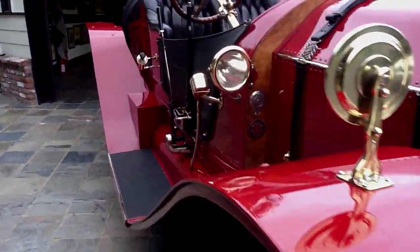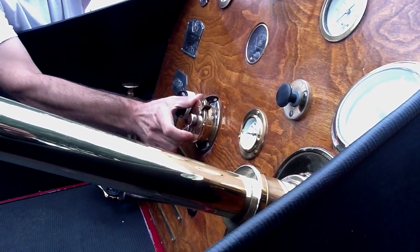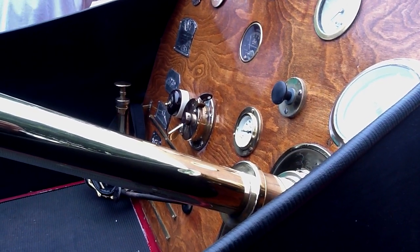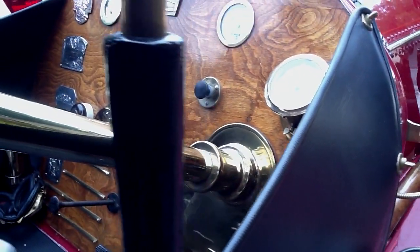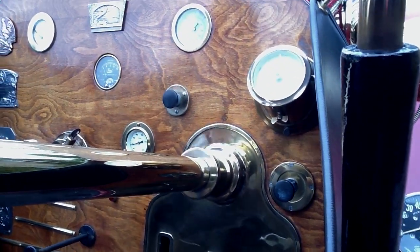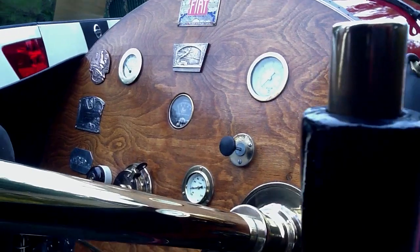The next thing we're going to do is get into the cockpit and show you what has to be done. Our main switch right here has both a battery and a magneto set up on it, and it's a little knob in the center that is both for start and run. We're going to put it in the start position and hook it into the battery. The next thing we're going to do is pull out the choke, which is down here — give it a little bit of choke. The next thing is to adjust the timing — retard the timing a little bit.